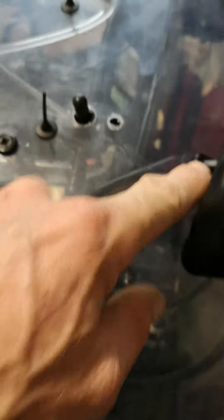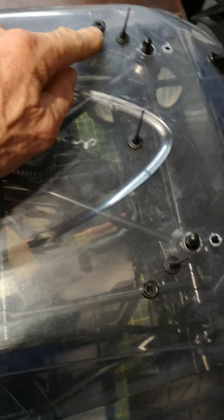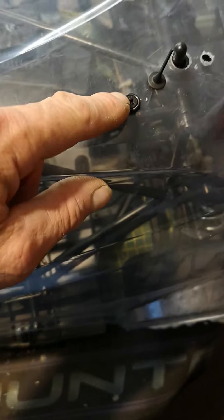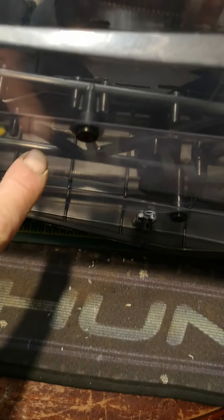The first thing is you'll get a bag of screws. There are two long screws for the wing that go right down through the wing through the body. There are loads of little marks on the body for alignment holes but not all of them line up, so I use a body reamer to make fresh holes — they weren't very far out. I started with four in the roof, then went to the bonnet, then the wings.